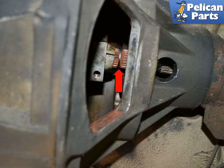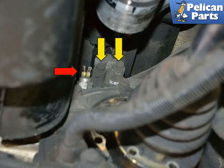Use a large flat head screwdriver and slide the coupler all the way back onto the transmission shaft until you see a clear gap between the torque and transmission shafts. Remove the electrical connections from the reverse light switch.